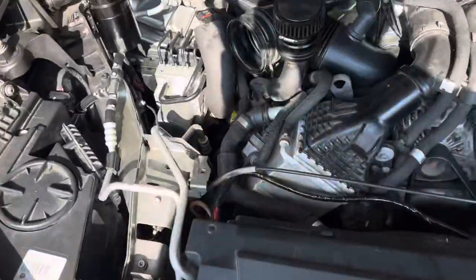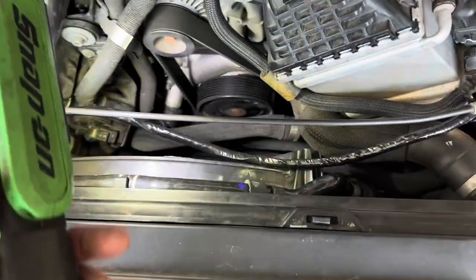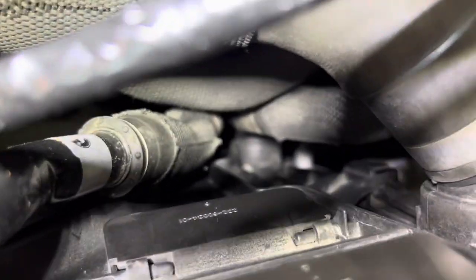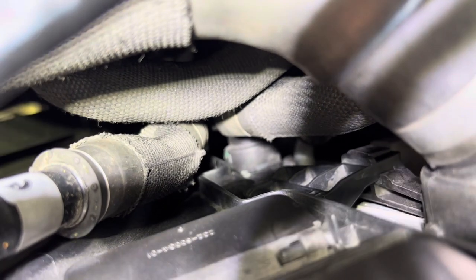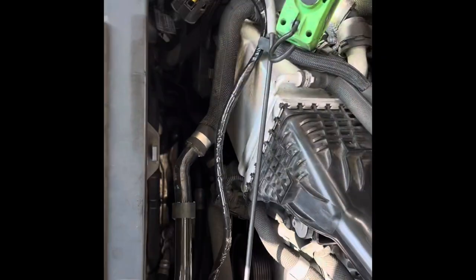With the brace out, we need to remove the engine cooling fan — it's not going to be too bad. There's a water line going crossways that just unsnaps here and there. The part right there is what holds it in place — you've got to unsnap that, and the same is going to be on the other side as well. I got the fan out of the way; there's a little bit of a challenge but nothing too crazy.